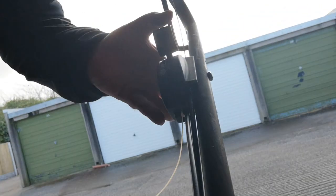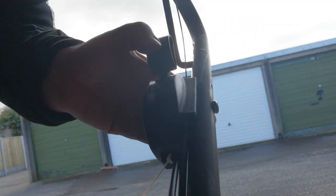As you can see, it's running, but it is hunting up and down a bit. I think that is because of the throttle — it's knackered. I've tried cable tying it on just to see if I can get it working, because when I was holding it down it was working perfectly fine. So I'll have to see in my stash, see if I've got one of these knocking about, and then that should be ready. So that's the Mountfield HP414 — date of manufacturing, 2011.